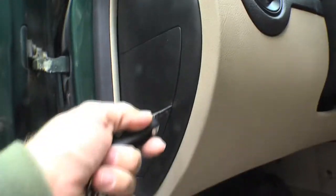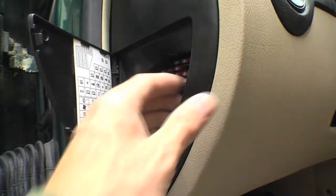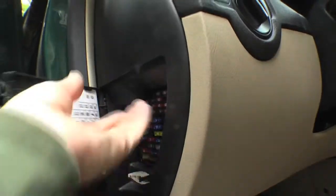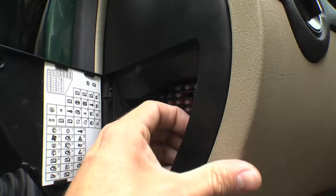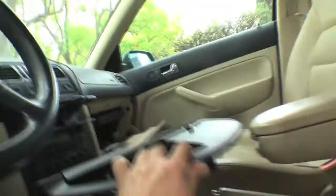Your key works here like so. We've pulled those two screws. There's a spring clip here, spring clip here, and spring clip here, and there's one under here that we need to get. So we need to pull the fuse door first. That comes off — put that aside so you don't step on it. Since we've pulled those two screws, that's the only thing holding this section on in addition to these spring clips up top, and you just pull them straight out like this. Now that plate's off.